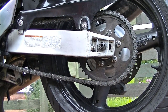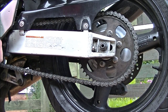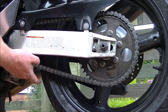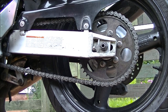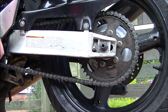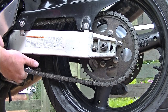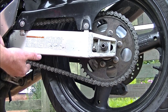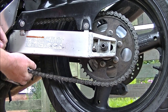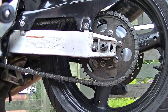This is just an update on the video I made about the chain adjustment on the Bandit 1200 being solved — and it most certainly isn't. As you can see, I've moved the axle nut onto the side Suzuki wanted it to be on, and the brake was binding. I don't understand why. When I had a look, I noticed when I was tightening up the axle nut from the other side it was simply pulling in the other side, affecting the alignment somehow.